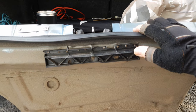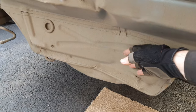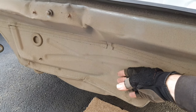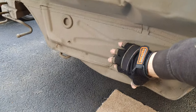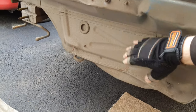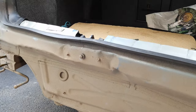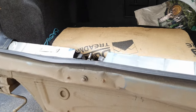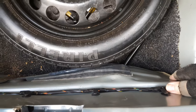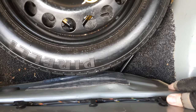In the centre there's a support for the bumper that's been smashed to pieces and broken too. This centre panel, which is the rear panel for the spare wheel well, that's been crushed in the middle as well as this section here, and that has pulled the striker slightly downwards so now the boot is a bit tight to shut and pulls below level with the bodywork at the sides. Here you can see a slightly clearer picture of how the wheel well has been damaged from the inside.